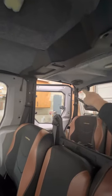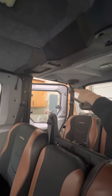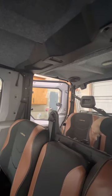If you want to add 24-hour power up here, all you need to do is run a wire down to the battery. That post is basically hollow — pull the headliner apart, there's a hole at the top, run your wire down, it comes out behind the firewall in the engine compartment, then run it back down to the battery.